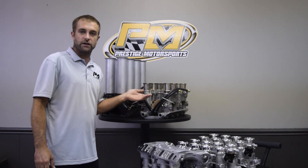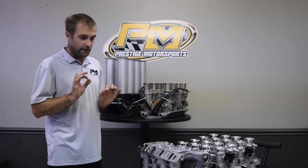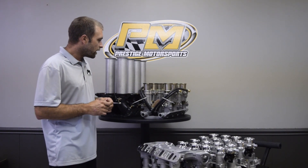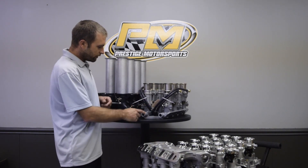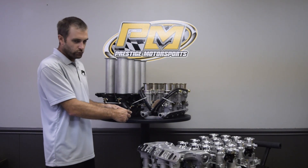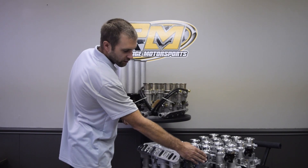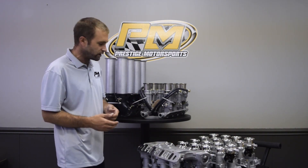One of the things with these systems you want to make sure of is fuel pressure cannot be over two to three pounds — that's very important. Just wanted to point out that it does not have a plenum. The water outlets are going to require a common manifold to go back to the radiator, whereas these newer systems use a thermostat housing, which is pretty common to what you see today.